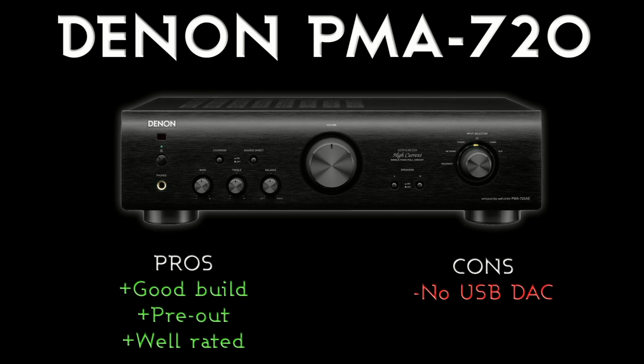That's very useful. On the con side, there are other products on the market, as I mentioned, that have a few more features, and it's a shame that they didn't put in at this price point a DAC, especially a USB DAC, so that if you're not using a CD player anymore, you're just using, say, a computer or a PC as a source, you can plug it in and go direct to it. This way, you've got to get a good sound card, and the internal ones are always a problem because they generate a lot of noise, so you'd have to get an external sound card, and it's generally a bit more messy. It's a shame it hasn't got a USB input. We would really like that. But apart from that, it's very good for the money. It's a good all-round amplifier.